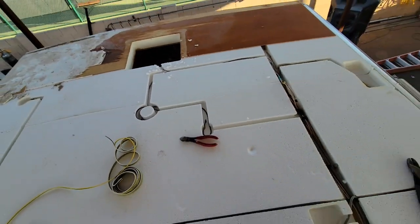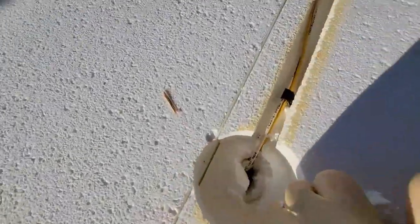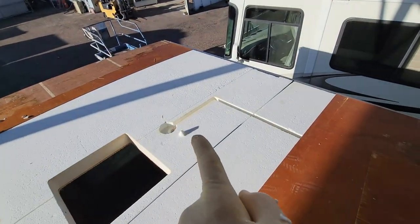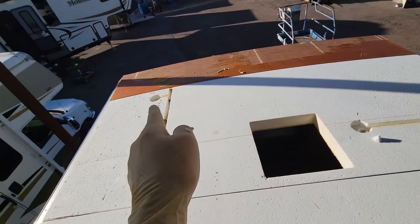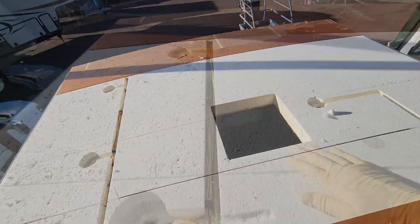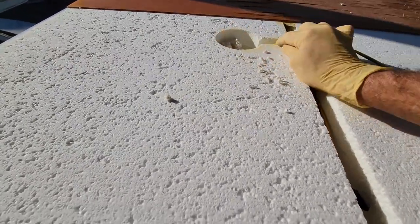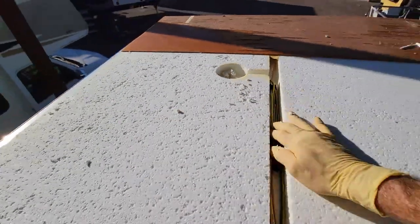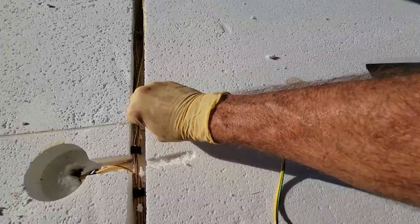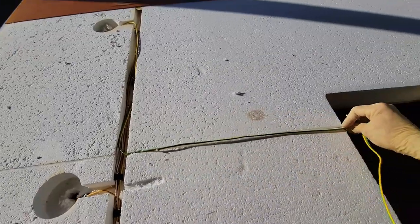You know, it's so much easier to do when there's not a roof in the way. I know what some of you might be asking is, why don't I use the wiring right here that goes to this ceiling light? That's switched from the wall, so in order for me to have power there, the wall switch would have to be on, which is not ideal. So that's unswitched power, and that's why I want to go to that one. And this wire, I don't need to hook it up currently because the connections are going to be in the closet where I can get the ground and power hooked up. I'll just pre-wire it from this pipe there. I was going to run a channel right there, but then I said, hey, you know what? The perfect groove for it right over to here.